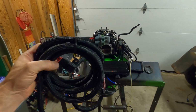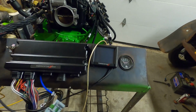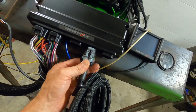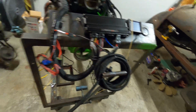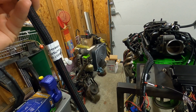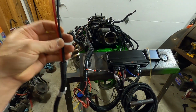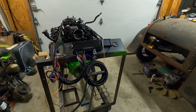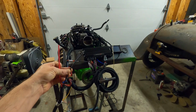So now we're going to switch over to our main power supply harness. It comes coiled up. We uncoiled it just enough. We'll plug it in right here at the port. I always kind of leave this dangle there on that handle, and this goes directly to the battery itself. So big hot, big ground, directly to your battery, no place else. If you have your battery in the trunk, you need to lengthen these wires if you don't have enough on this coil, which they give you plenty, but you can shorten this if you need be. You can lengthen it, but directly to your battery.